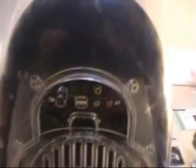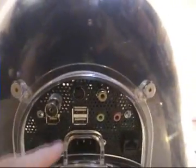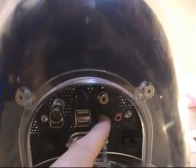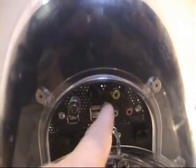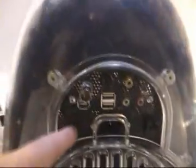And then there's just the various ancillaries. You'll see on the bottom here I've actually got all the rest of the connections. Right, so the normal power supply connector location, managed to mount there. This along here is actually a front panel that matches the motherboard. It's just with your firewire, second set of USBs, headphone / line out, and microphone. And at the back here I've got TV and S-video, which are just the outputs on the motherboard, and then coax in for the aerial for the TV. And then at the back here, hard to see, but there's the Ethernet port here, power switch here. So with that you've got all the controls you need, which is lucky because the rest of the bubble is sealed. It doesn't have a CD-ROM drive, that's true.